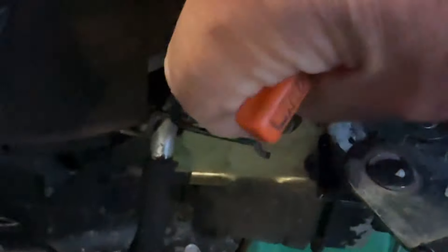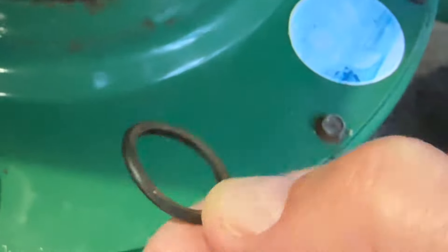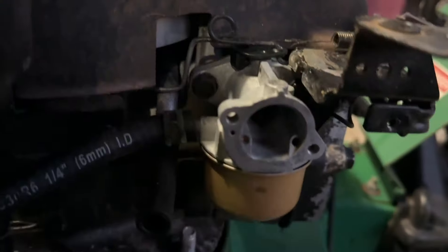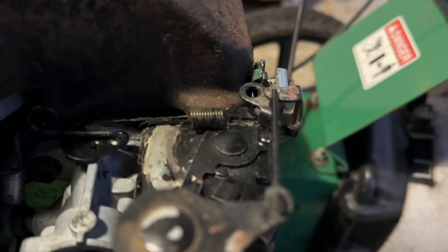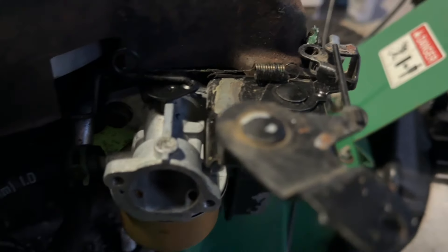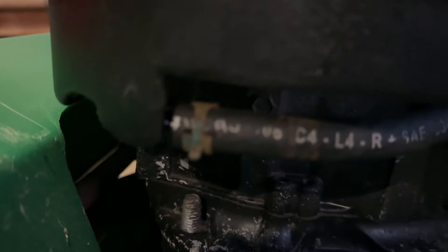We will see the carb mounting here — we've got an old o-ring on here as well, and there's a new one in the kit. So we'll have that off and replace that as well while we're doing it, because you never know, the seal on that's obviously been on here a while. That doesn't look too bad, but we've got a new one, we might as well replace it. Right, that's the carb fitted back on. Linkage is on there. I've yet to do the governor spring — just needs clipping over there. Fuel pipe's on, clamps are in position, so that's done.